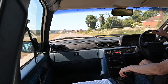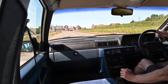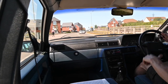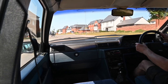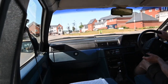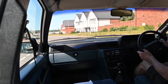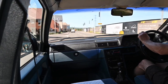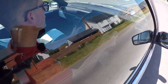But when I started reading accounts from the 80s where kids would bounce the front of the dad's new Volvo 700 and see how many times they could make the bonnet go up and down — it turns out the wallowing is actually completely normal. It does mean you can glide over speed humps as if they're not there and bad road surfaces mean nothing to this car. It also helps that it's only got 14-inch wheels, so the tyres are quite tall, giving even more suspension travel on top of the already impressive ride.